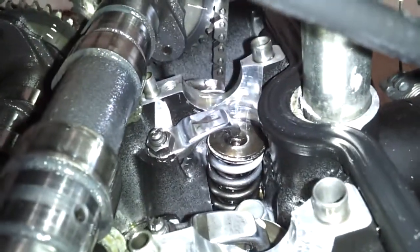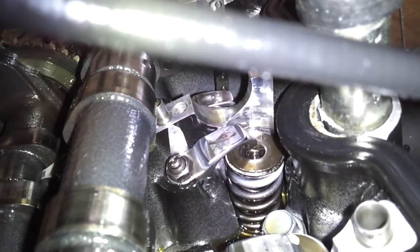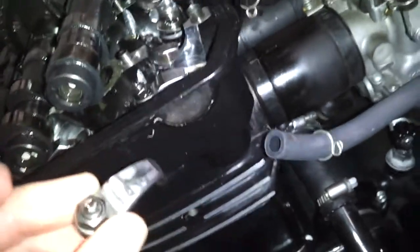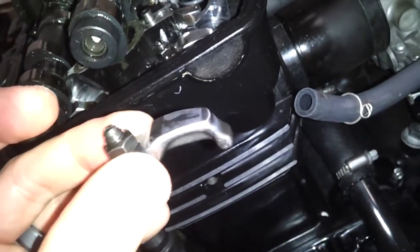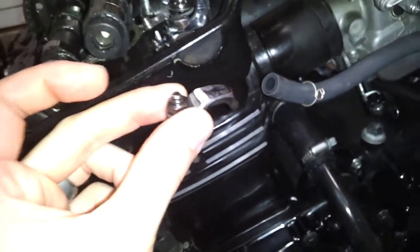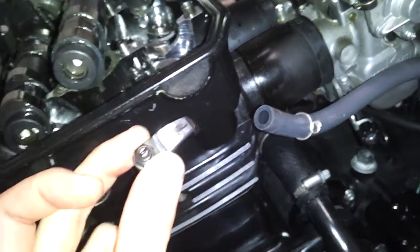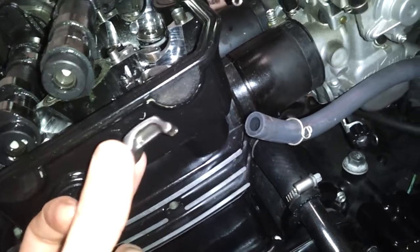This valve right here is the one I'm having problems with. You can see there's not-so-great wear on this rocker arm where it was knocked sideways. Fortunately the little feet aren't broken, but the screw on top isn't good by any means. It's not wearing on that the right way. When I had this open a couple days ago I had to order a new rocker arm — I ended up ordering four. One had broken, one was damaged where I didn't feel it was safe to use again.